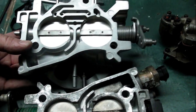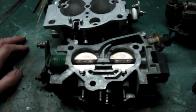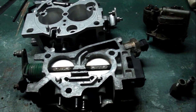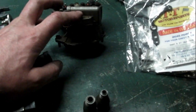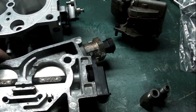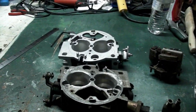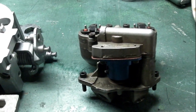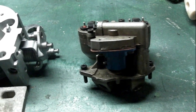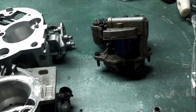I'm going to slap this on and do some data logs to see how much my fuel curve changed, if it's leaning out. I'll leave the pressure where it is. I was running a little bit rich on the bottom end at 14.5 — especially at idle, it's running richer than it needs to be, so I've got to tune that out. When you get one of these adjustable fuel pressure regulators, you want to adjust it so you're not running lean on top, and then you can tune the bottom end — make adjustments in your tuning program to lean it out if it's running too rich. Mainly what you're doing when you adjust your fuel pressure is setting it for wide open throttle, so you're not running lean with all the modifications you made.